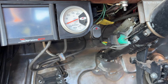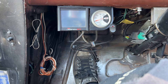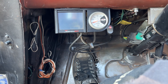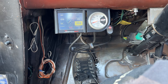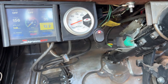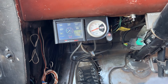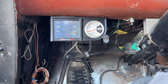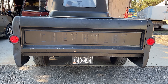I've got it all wired up according to my diagram, crossing my fingers hoping it's all going to work. When I turn the key on, this little LED light on the toggle switch should light up. Boom — there you go, it lights up, and when I shut it off, it goes away. I have it wired so the brake switch is turning the torque converter on and off. When I hit the brakes — off. Release the brake — comes back on. Perfect. And we still have brake lights. Let me wrap up this wiring and then let's go for a test drive.